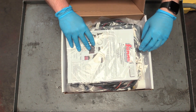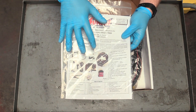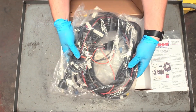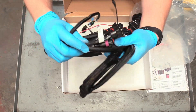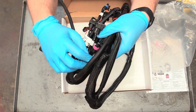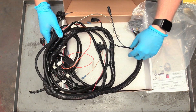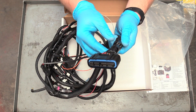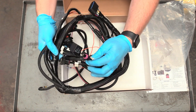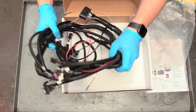We got some instructions right off the bat — definitely give these a read over because there are things in here you're going to want to know before you try to start your car or truck. It comes with a complete wiring harness. They use OEM-style connectors — that looks like an OEM Ford connector, with little safeties and seals to keep water, dirt, and crud out. Little blade connectors, and the big daddy connector for the brain. And it's all labeled — TPS right there, injector 3 right there.